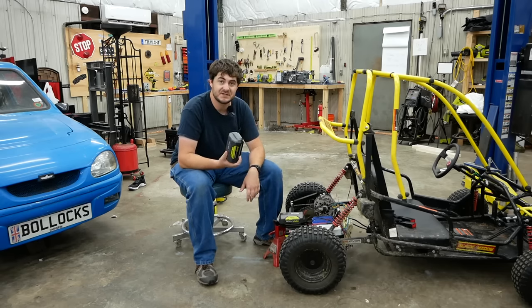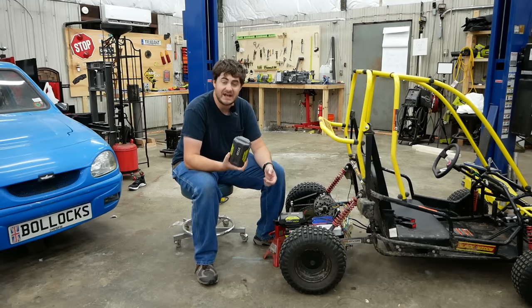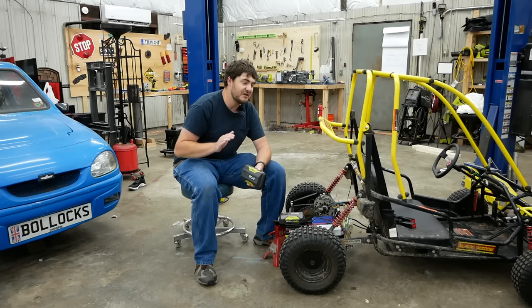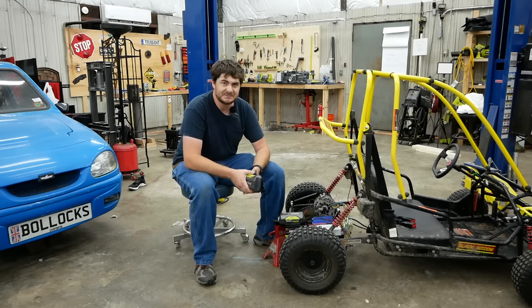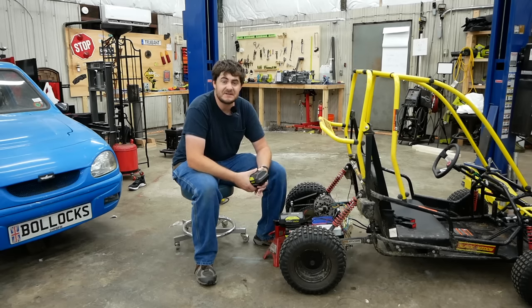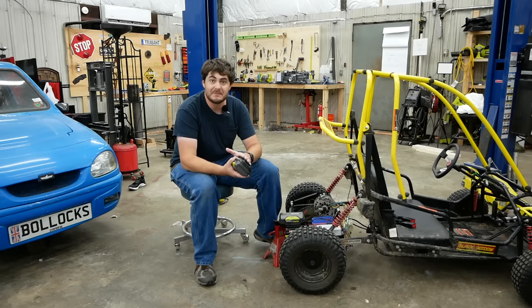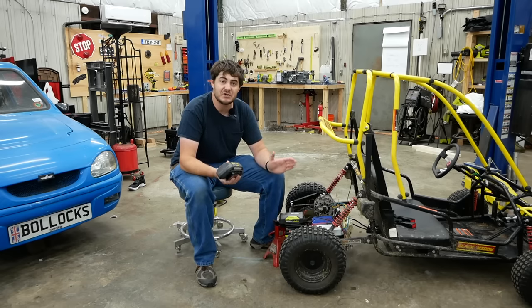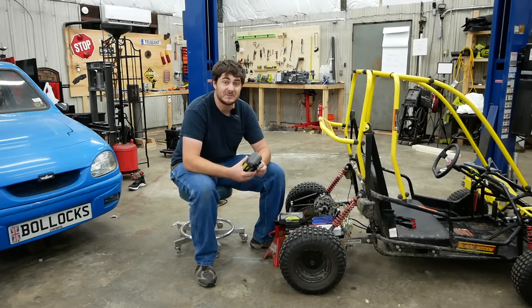So what I'm going to do about this is give up — for now. I'm stopping on this project and coming back to it in about a month, because the startup problem isn't the only issue. Those batteries aren't going to work either. I figured out ahead of time they'd be sub-optimal: the motor controller is 1,500 watts, and the two batteries together add up to just under 300 watt-hours, so at full power this thing would only run for a little over 10 minutes. But it's worse than that — during test drives, the motor controller cuts out almost immediately, after about 15 seconds. If I flip the ignition off and back on it comes back, but cuts out again 15 seconds later. I don't know if it's the BMS modules in the battery or something with the speed controller.